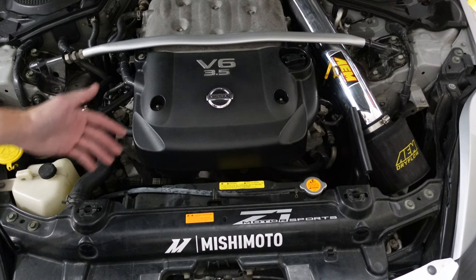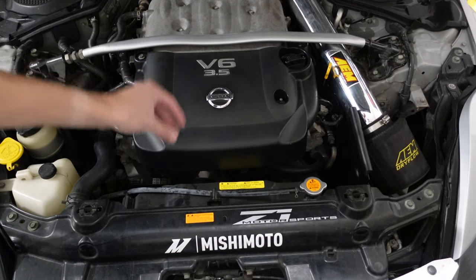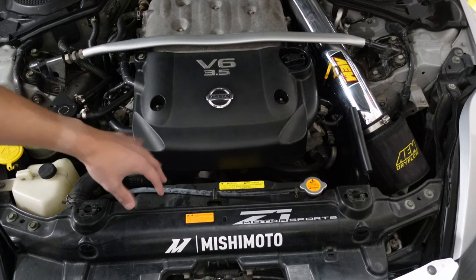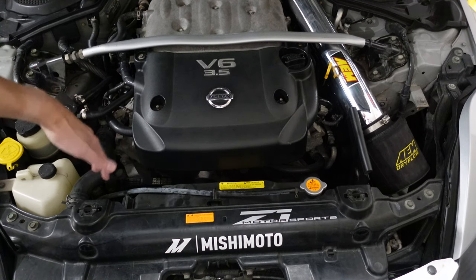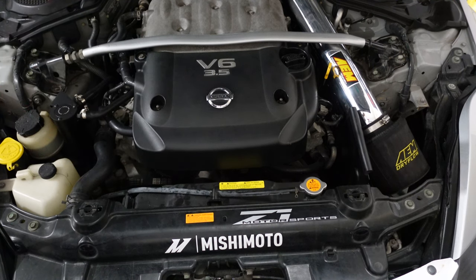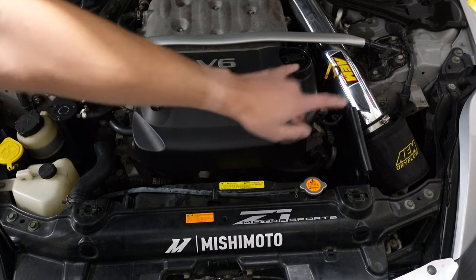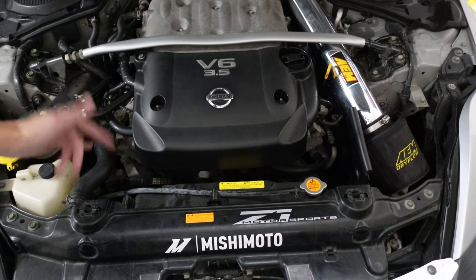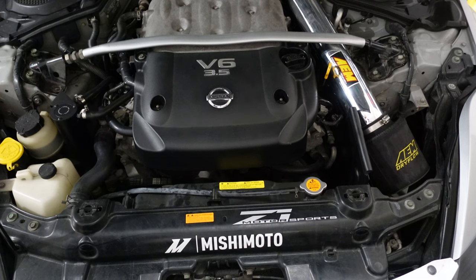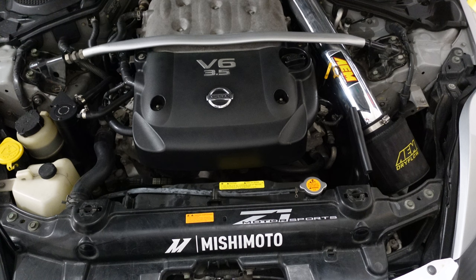Here's the OEM fan — as you can see it takes up a huge chunk in the front space of your engine bay. These Mishimoto radiator fans are going to be super slim and look a lot nicer and cleaner than having this big chunk of massive plastic. First, all you have to do is take off your cover if you have one, then take out this tube. There's a 10mm bolt on the left side and a 10mm bolt on the right side that's behind that heat shield, plus a couple of wiring harness clips. The last key step is taking off this radiator hose right here — it will introduce air into your system, but if you bleed your radiator properly you won't have any issues.